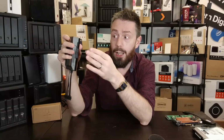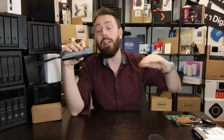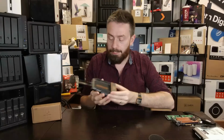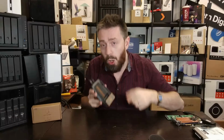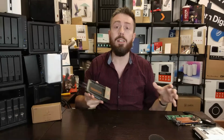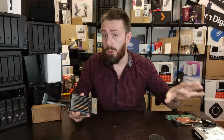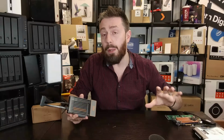You can save that for maybe an expander box there for you to touch on for your multi-bay RAID enclosure running into it. And the thing that makes this the most interesting is because the CPU inside there is an x86 rather than the traditional ARM that's found in Raspberry Pis. And again, we still don't have full confirmation on the Pi 5 when it rolls out, and we can only really go right now by the Pi 4. Because that is a Realtek and it's an ARM, it limits some of its capability. It doesn't make it a non-powerful CPU.